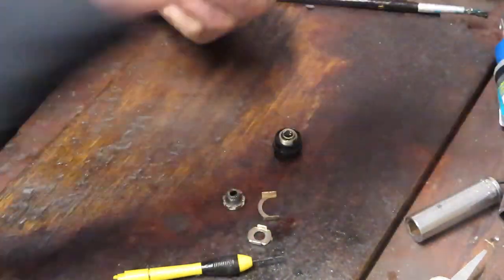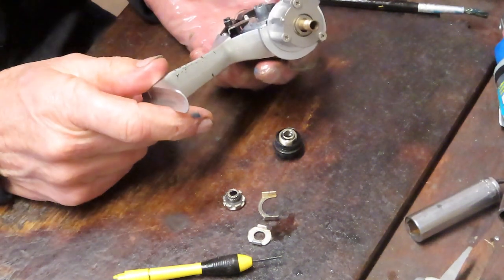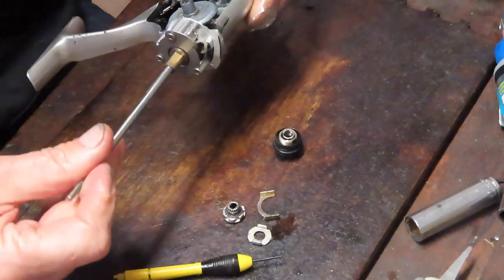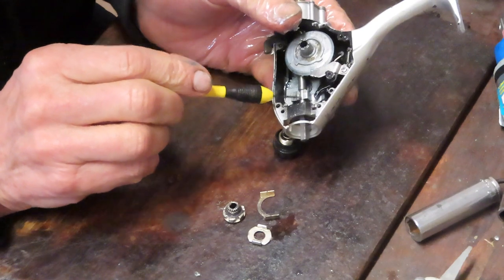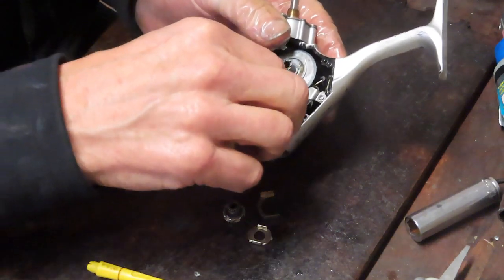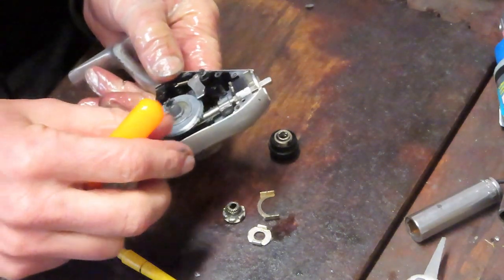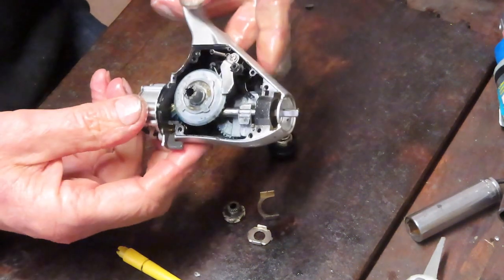Remember — we had a lock in the case, so if we put the rotor on at this point we're going to have trouble. We've cleaned the axle shaft with a light coating of grease — don't put a lot on, you're only going to squeeze it out. The axle shaft goes in next. You can now better see the two slots here for that C-clip, which holds the axle shaft in place. Line it up so you have access on both sides, flip it over against the crosswind block, then push it in to finish seating it. Use a fine screwdriver to seat the clip properly.